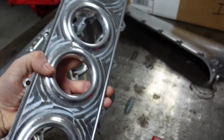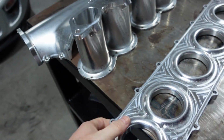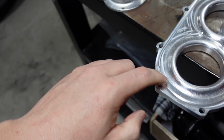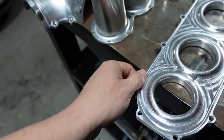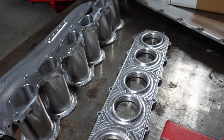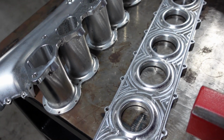This here has one giant groove in it though. So there's 3 separate seals, not just the O-ring seal. This side has the O-ring seal. This side has one giant seal. Now there is no O-ring out there. So this is the style where you actually have one giant piece of rubber. You cut it and glue it together. Yes, that's actually something that's done. That's done in all the big V8 stuff. All those big plenums all use that style.